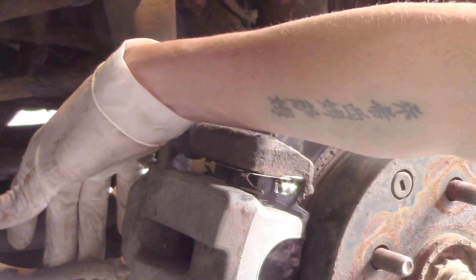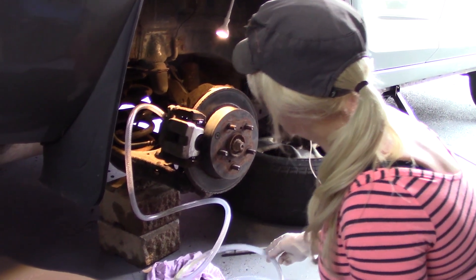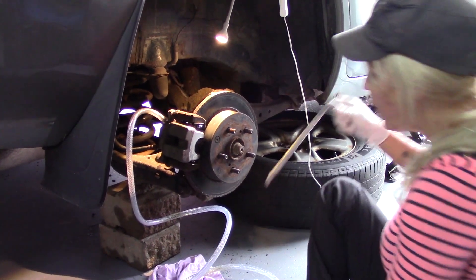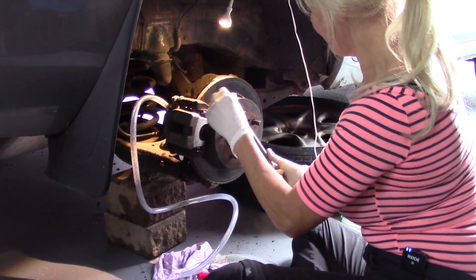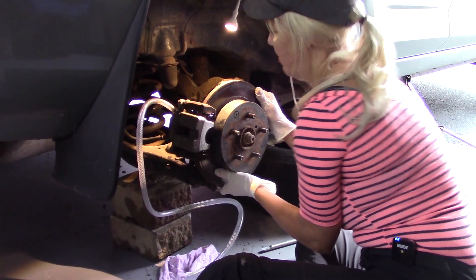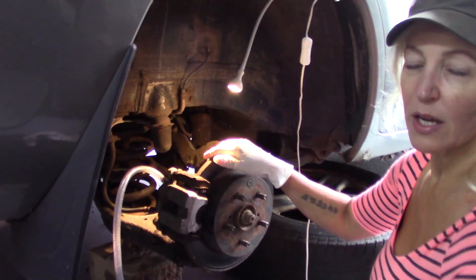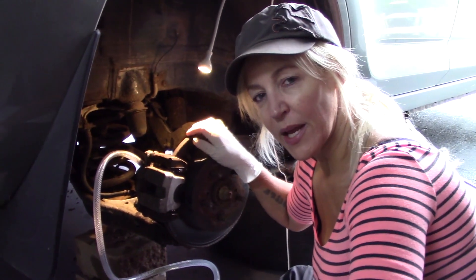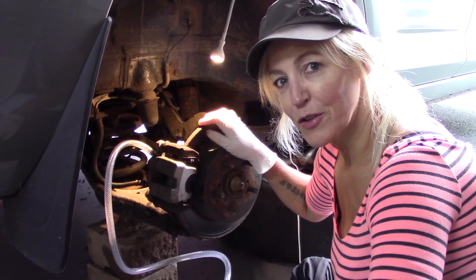Only thing left to do on this side is bleed the line right here. Got the lines bled. Having a little trouble with the disc — I know it's supposed to be pretty snug. I took the wrench and there's not supposed to be a lot of play there, but a good trick is to use your wrench to get a little movement. I can hear a little scraping, but until the new pads get seated into the rotors we'll have a little sound. Usually it lasts about a day or two depending on how much you're driving, then once they're seated it all clears up.